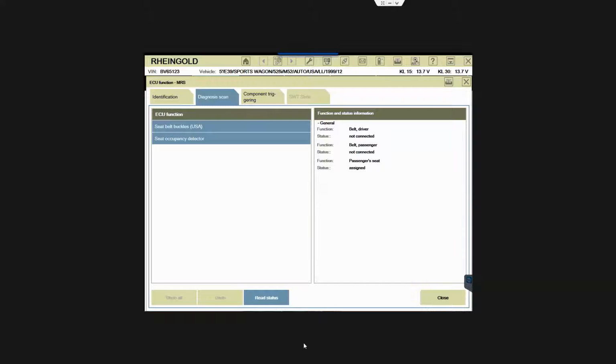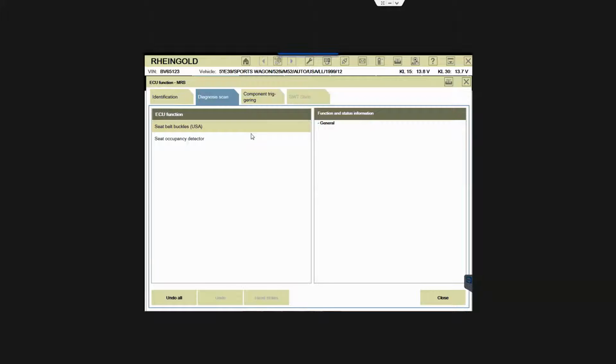I know that part, but I thought they had some other, much more live data where you can have multiple entries. No, it depends on the control module, how much information BMW wants you to see. If the automaker wants you to see two things, that's all you're going to get, unless you go to an aftermarket scanner. Sometimes I use an aftermarket scanner or AutoLogic at my brother's shop. They give me more resources. I stop by his shop on a test drive, since it's like 4 miles from my work, and I just connect it.